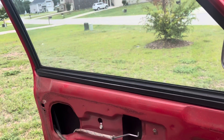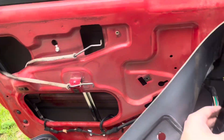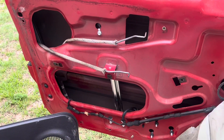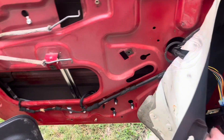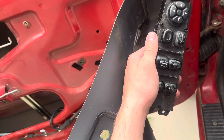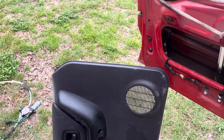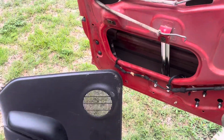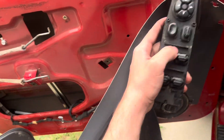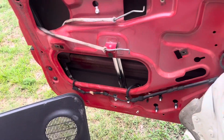It's super simple. I got it up, but this switch is messed up too, which I just figured out. If I mess with it enough it'll work. I ordered another switch — they're about 20 bucks — and that might have been my problem all along. I did get the window to go up, which is great because I don't have to worry about rain coming in. Check your switch first before you spend 60 bucks on a regulator, because I might not have needed it. It doesn't hurt to have a new one though. Sorry I can't show it rolling up and down, but thanks for watching. I hope this helped. Just stick everything back in place like you took it off — it's super easy. Enjoy your Jeep.